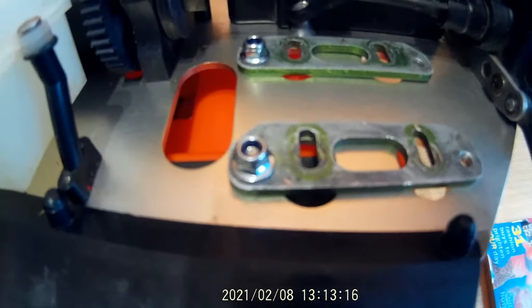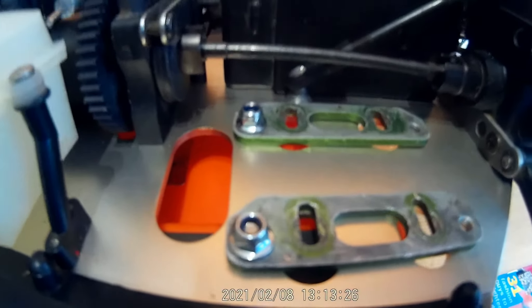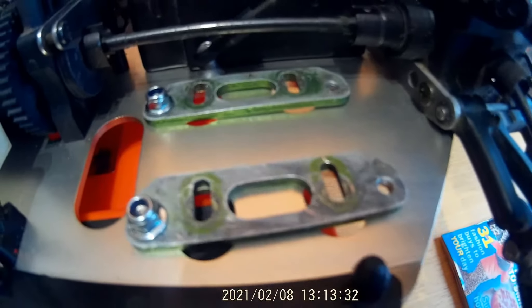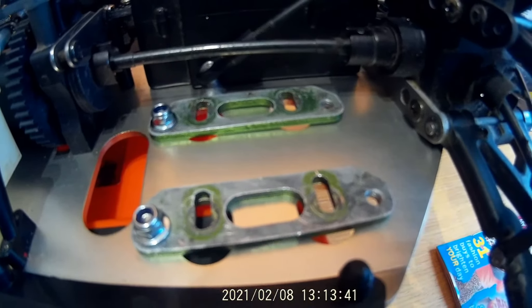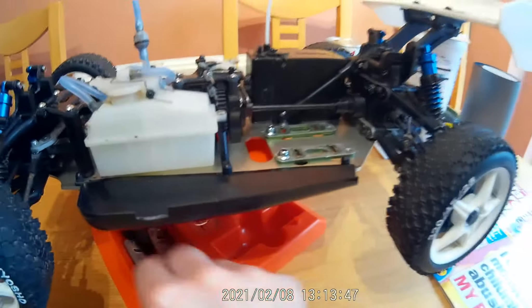One of the issues is the fitting bolts - you can see they're about M4 wheel nut bolts. The bolts that go through stick up and you should have another one on the other side, because the engine fits in there and sort of gets in the way. Those holes at the end of those plates are threaded and you're supposed to have short blind bolts that go up, fit flush, and bolt in from the bottom of the chassis.